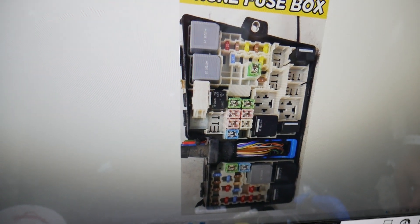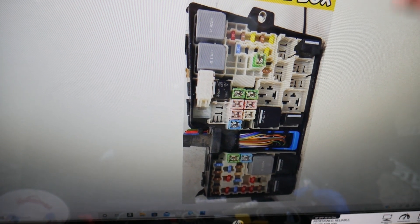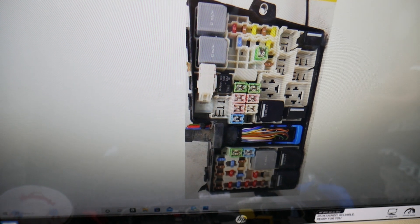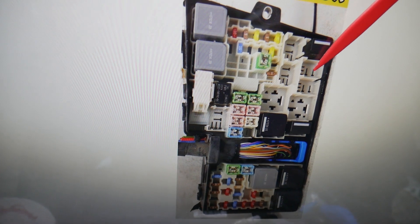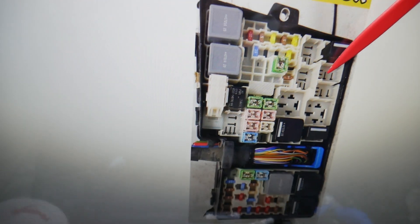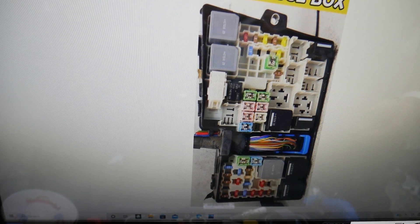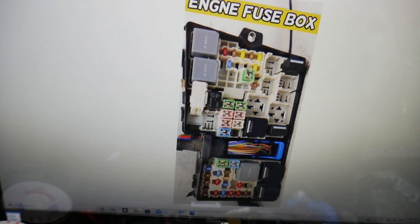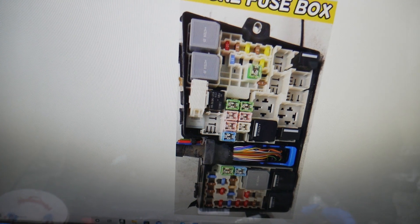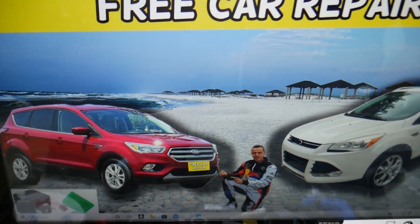So the headlights relay — you may or may not have one, and if you don't have one we'll explain why. If you need to buy any relays, parts, tools, or fuses at a good price with quick shipping, we will put the link in the description below. Some of you may have a headlights relay and it will be relay number four right here. But if you do not have a headlights relay, you need to check your headlights fuses — you have up to four of them, and we have a special video about that. If it's not there, it's an integrated function. If you don't have the relay, the relay function is integrated in the BCM — the body control module. Hopefully the video will be helpful. Thank you for watching. See you next time.